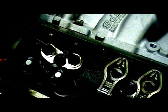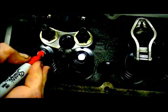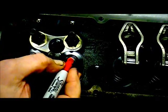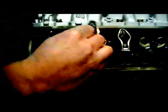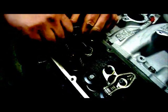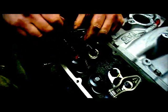The way to check for proper rocker geometry is you take a felt tip pen, blue dye, or whatever you want to use to color the tip of the valve — not the rocker. Then we set the rocker on there, try not to disturb our ink. We're gonna run the polylock all the way down and set it at zero lash.